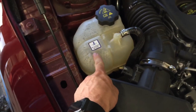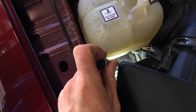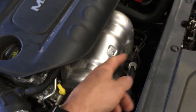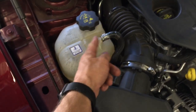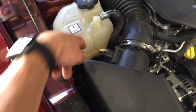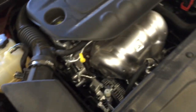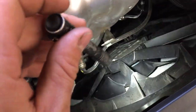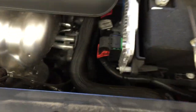When I first started seeing these, it was kind of tricky to diagnose at first, because I'd see a bunch of coolant residue underneath the reservoir. I later found out that when these engines were overheating at idle, it was boiling out the top and running down the fender with the splash shield. That made me initially think it was a leak, but after I tried to turn the air conditioning on and it wouldn't cool and the fan didn't move, I knew right away it was a problem with the fan or the fuse.